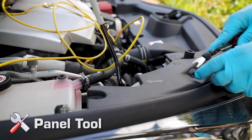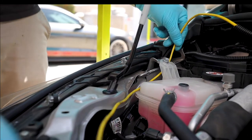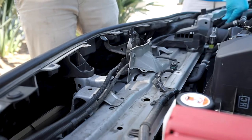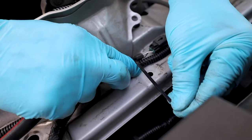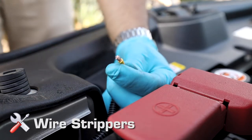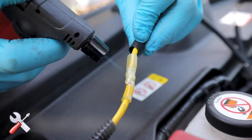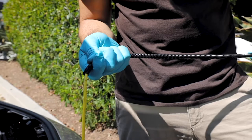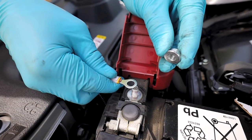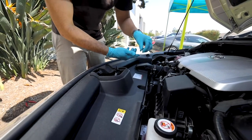Preparing the power wire path to the battery. Remove the seven clips on the front panel, then lift the panel out of its rested position and run the power wire through and towards the battery terminal. Strip the power wire, insert it into the butt connector and crimp. Use a lighter or torch to activate the heat shrink as well as the built-in solder on the butt connector. Install the corrugated split loom over the power wire. Remove the 12mm nut on the positive terminal of the battery, install the OEM Audio Plus ring terminal, and reinstall the factory nut. After running the power wire with corrugated loom, reinstall the panel with the seven clips.